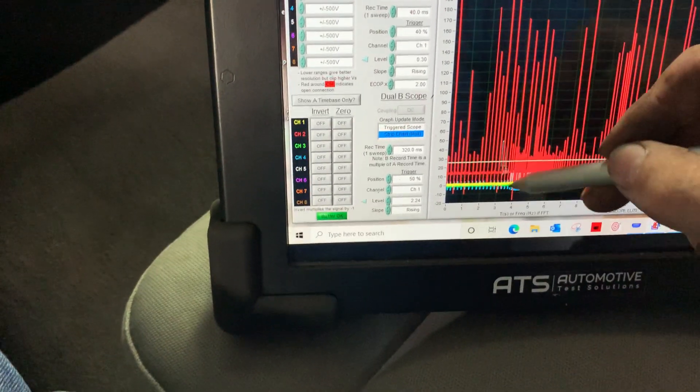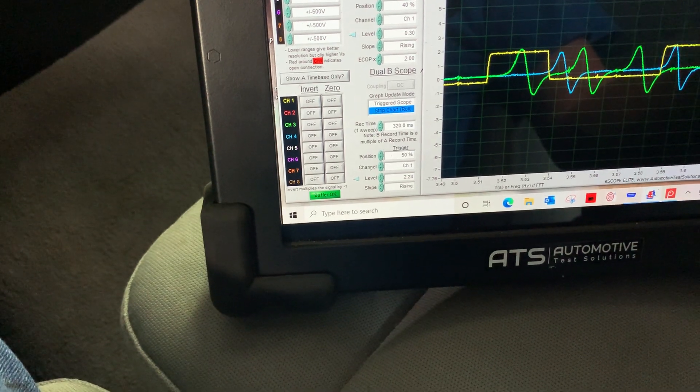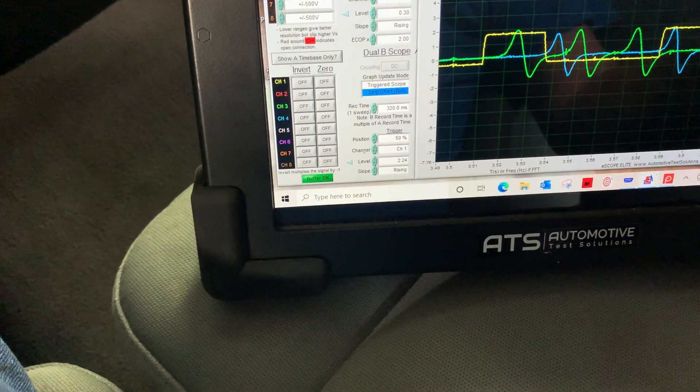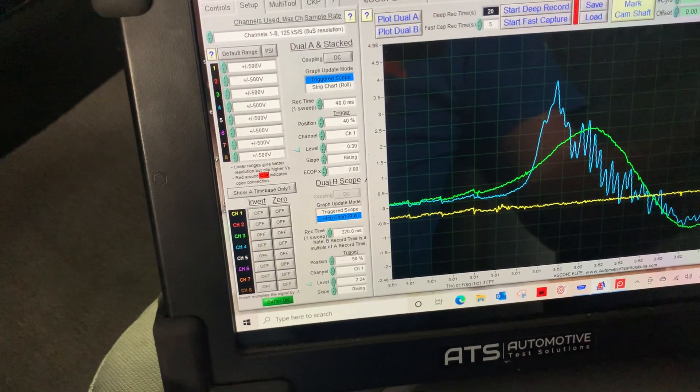Let's move in here. We'll go back before the computer started commanding duty cycle and see how bad it looks. This one is just about the time the event started. Yes, timing has moved considerably and then we got a distorted signal. I'm assuming that's when knocking and pinging is going on. That's kind of odd — so it doesn't look good.